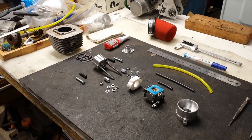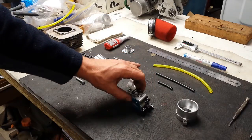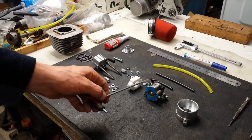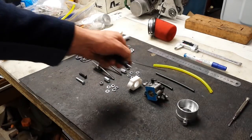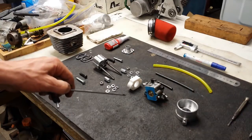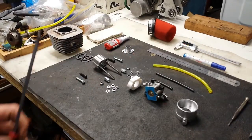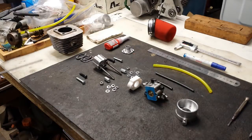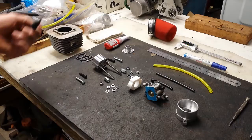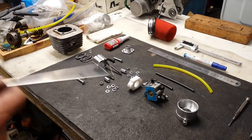The 130mm length of fuel line hose is used to get a crankcase pulse from the crankcase up into the carburetor. This particular part of the carburetor receives the crankcase pulse line, which then goes around to the block of the two-stroke engine. You can operate these without a pulse line but they just do not work properly — you need that crankcase pulse to operate the diaphragm. You will also need Loctite 222 or any generic low-strength thread lock, which will be demonstrated later in the video.